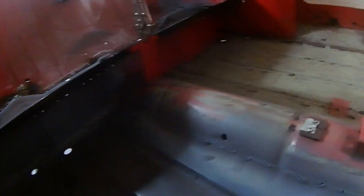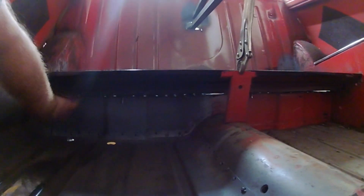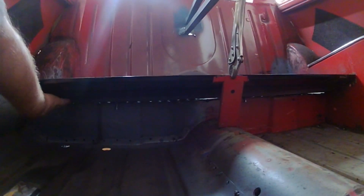I've put a clamp on here to hold that in place just now. This won't be getting welded because the floor needs to be removed. I've put a couple of bolts in — one there, one across here — just to pull that tighter. So it's tight enough there. Again, the floor is getting replaced so this isn't going to have to be welded at the moment. When you pull all that tighter at the back — you can see it now pulls this flange up. Still needs a bit of work; the flange is flexible. It's close enough for me to be happy. The support bracket here — close enough — going to get welded on. I think I've done as much fretwork as I can at the moment. I'm just going to start plug welding, taking my time, making sure I'm not going to have to go back and do work for myself.